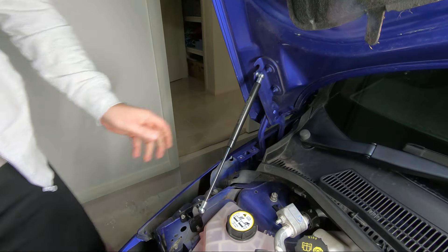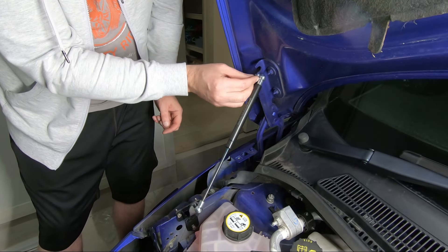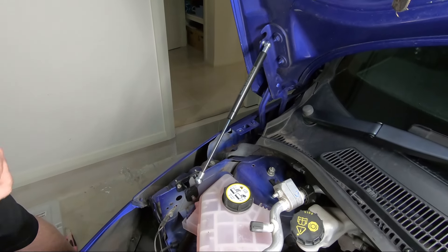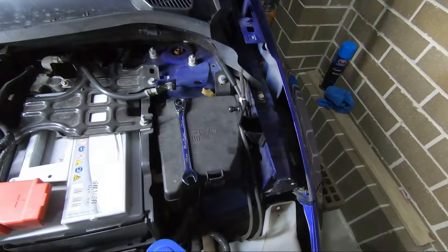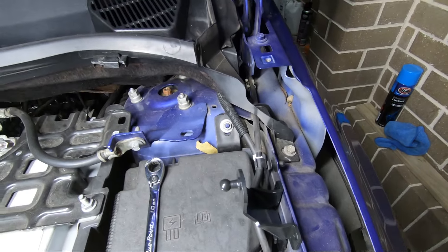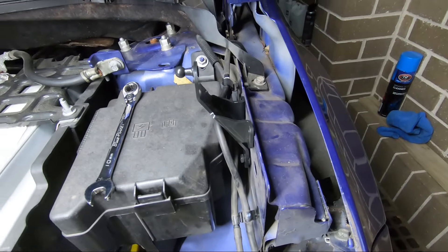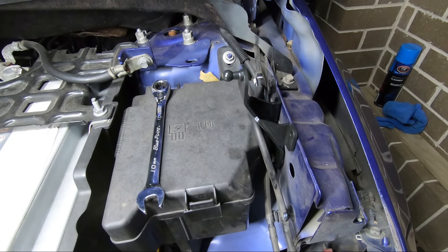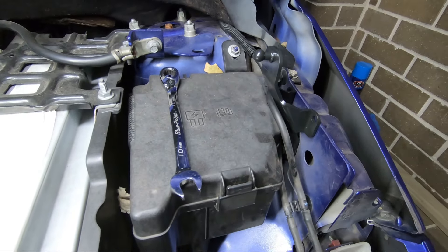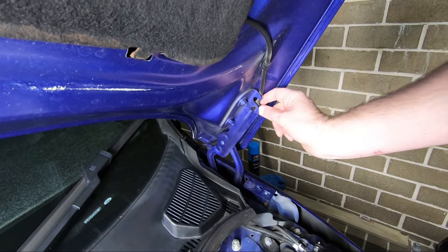Now that's all securely in place. You get your little locking part — you'll see the two holes, they slot in around like that. Same on the bottom. It's a little bit fiddly bringing the light around. You've got these two hoses here that are clipped in; I unclipped them both up there and down there to get a bit better access for that bottom one. I've seen people say they've undone the fuse box and moved it out of the way, but with a little bit of fiddling — probably a minute — I did manage to get that in without removing the fuse box.